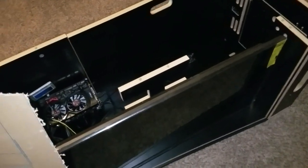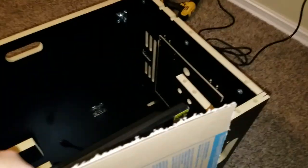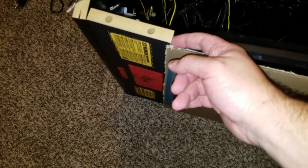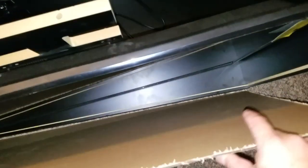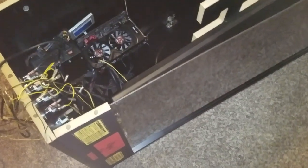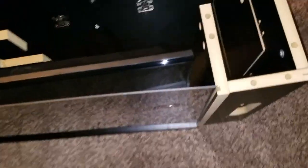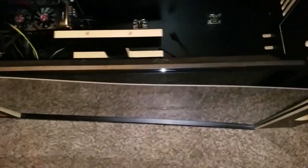We're almost done with the playfield already. What you're going to do is pull any sticker film off your monitor, get the playfield plexi — it's double-sided with brown paper to protect it. Peel that off, make sure everything's clean, and then slide the plexi in. It's going to go on top of this, hit the front piece, and slide into the slot. Make sure that channel is clear. You can see it's a perfect fit, and there's enough overhang for the other side.